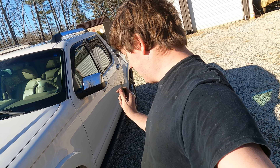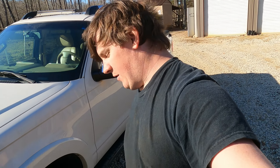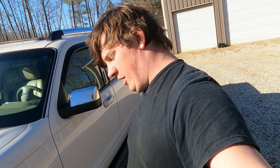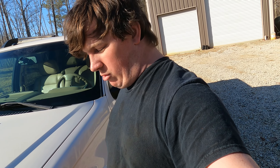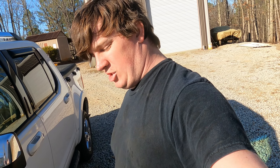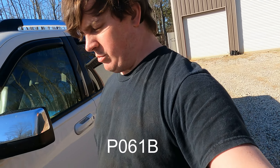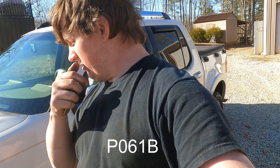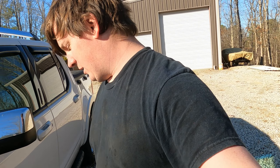Here we are. The last time you saw us, we had this thing just sitting idle in the driveway. Me and Jason since then took it for a test drive — it's been probably two weeks since that. Drove it, it ran okay. Had a stumble at about medium to half throttle at low RPM. Came back, pulled the codes — it had a P061B. Which is supposed to be something related to the air filter and the mass air meter. So I went ahead and changed that just to be sure. That did not fix it — it still has that code and it still has that slight stumble.